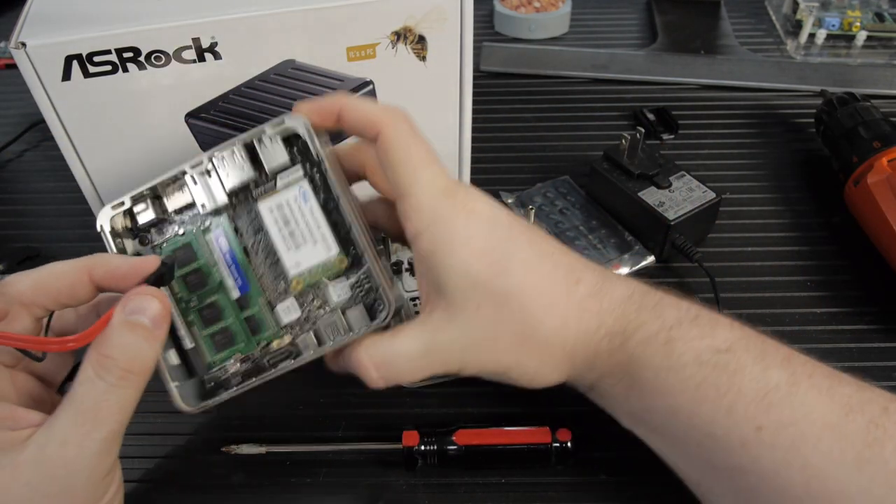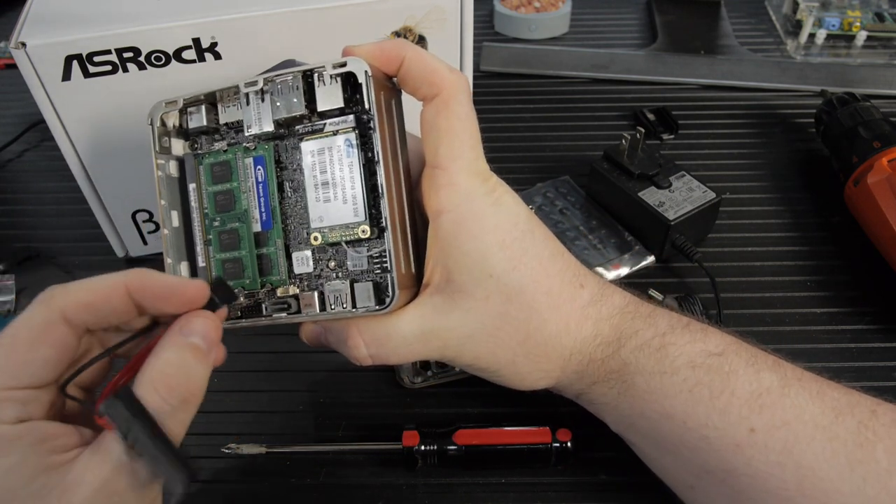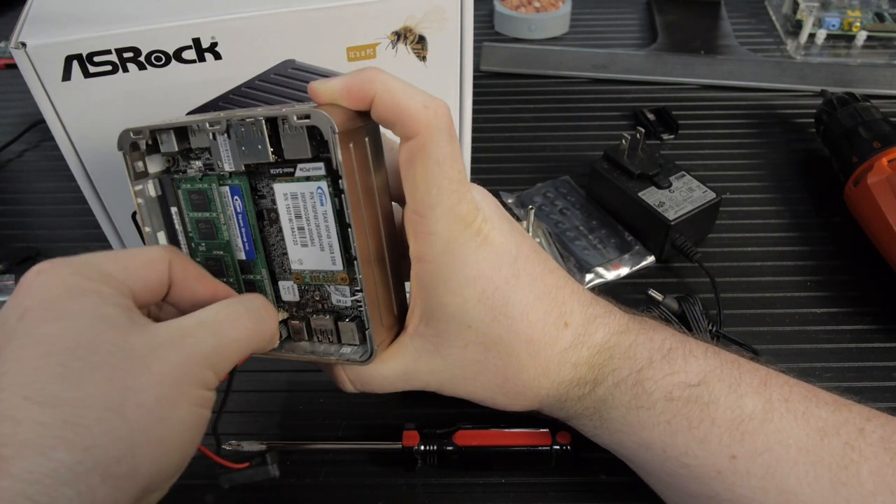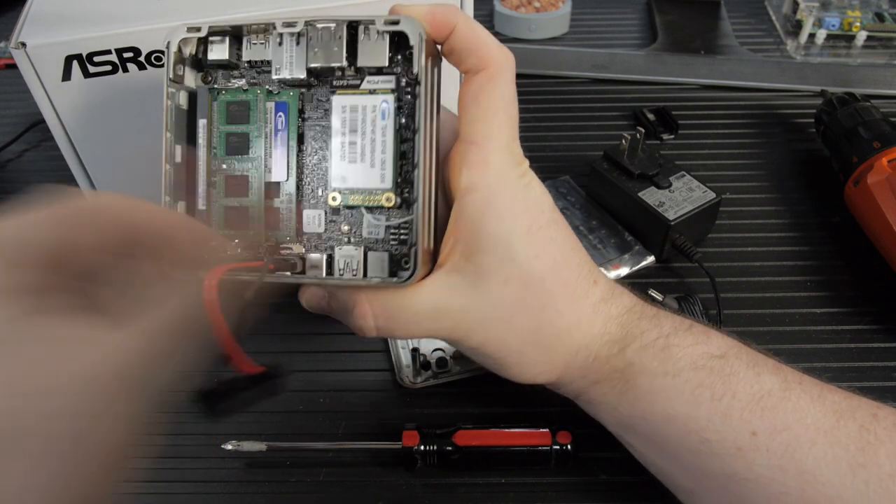Also in the box is a special two and a half inch SATA cable. This cable goes from the SATA 6 header on the motherboard and a special funky power connector out to a normal two and a half inch SATA drive connector. This is really important — do not lose this. My recommendation is to store it inside the box right away. Even if you're not going to use a two and a half inch drive, go ahead and take it apart and hook the cable up to the headers inside. It's not going to hurt anything rattling around in there, and there's no fan for it to get caught in.